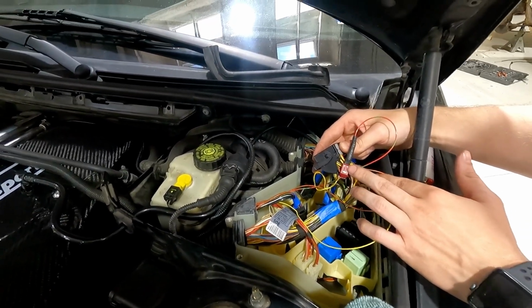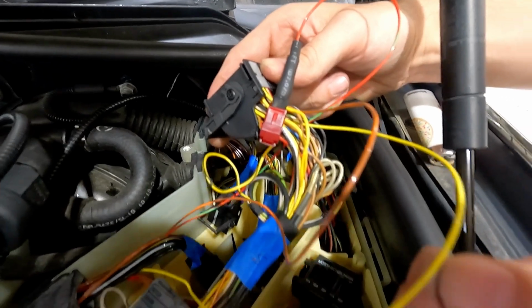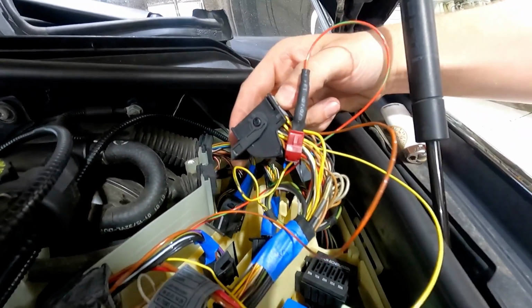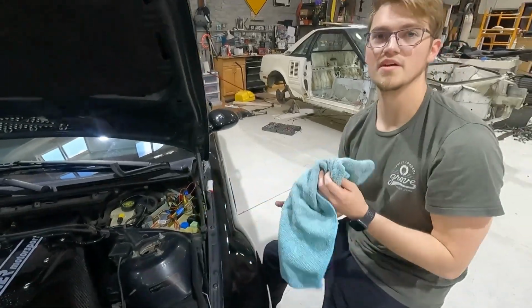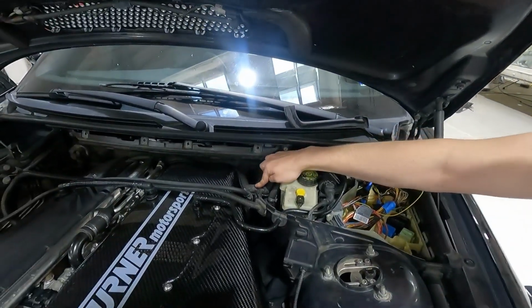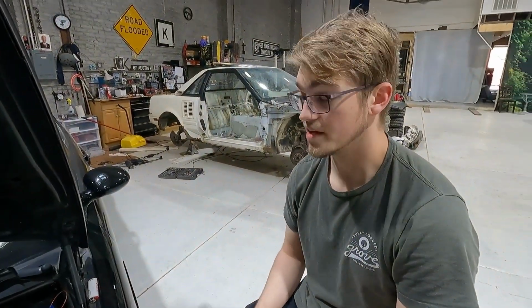They supply this little connector. And then it also comes with a yellow wire, which goes to pin 18, and a brown wire, which goes to pin 16. The pin markings are all labeled inside. It's pretty self-explanatory. I recommend routing everything through different gasket points like this that make this whole area waterproof and debris proof. And heat proof.